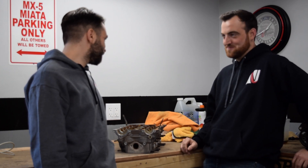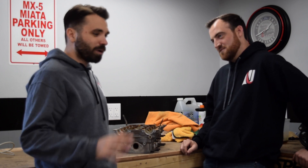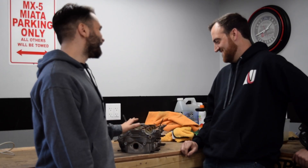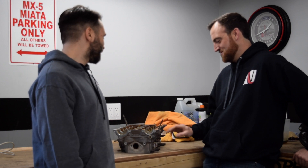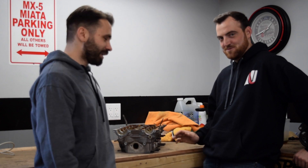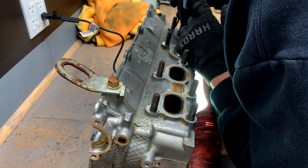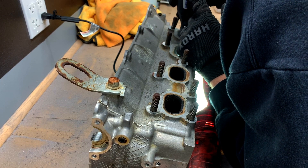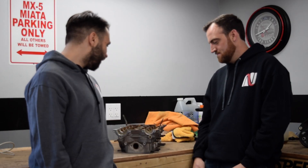We're smoothing this out because we're in there anyway, might as well. A lot of what we're really trying to do is just take what we've got and optimize it — it's a little design, not the best from Miata. Let's clean that up, make it as good as it can be without trying to redesign anything with the Dremel. The answer going forward would just be a CNC milled head — just buy it once, be done with it. We didn't do any exhaust matching, no gasket matching on that side — they flow well enough as it is, and you want to keep the air nice and straight. Simple, less is more.